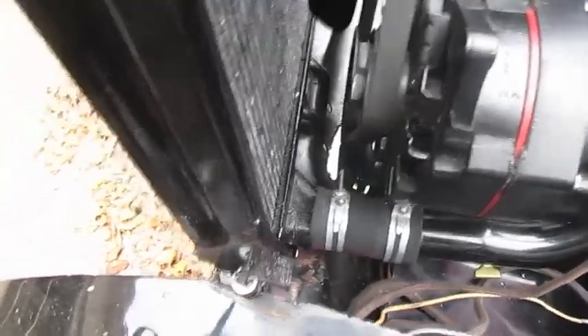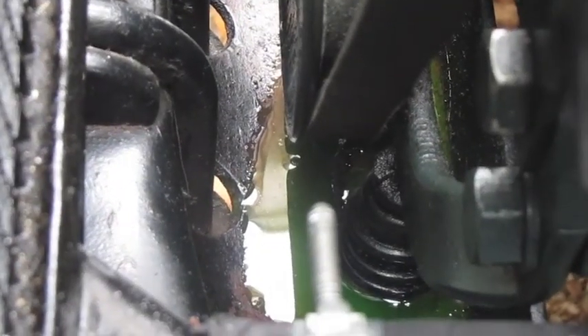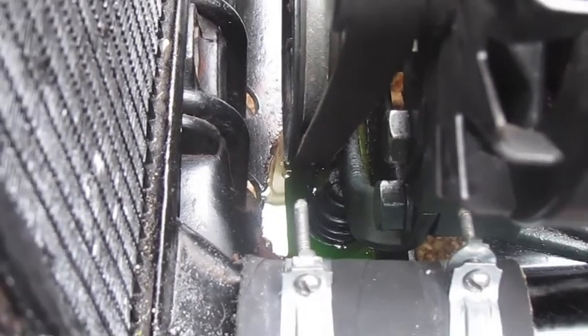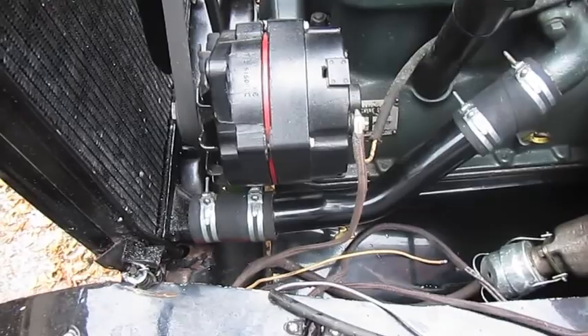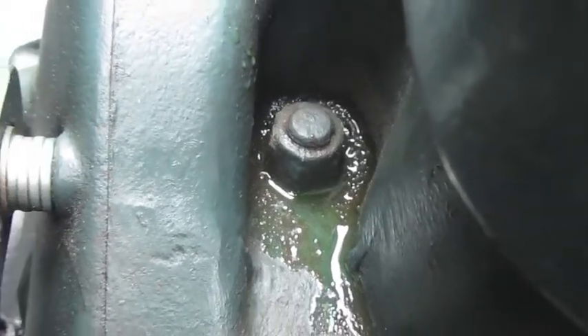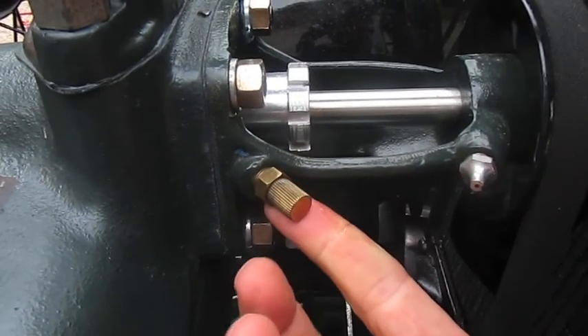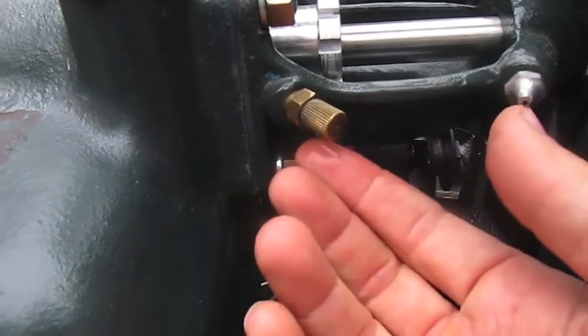That was an expensive lesson in time. You'll see some liquid accumulate in the bottom — it's a little green because I mixed in some antifreeze with the water. Use distilled water mixed with antifreeze if you can. That's what happens with the overflow when that hose isn't in place. I don't really have any other leaks — there was one spot of coolant fluid I traced back to what's supposed to be a leakless pump, which seems to be leaking. The hoses themselves weren't leaking at all, which was great.